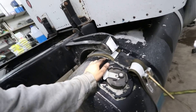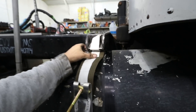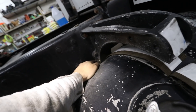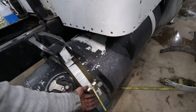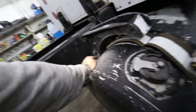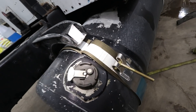I got the strap around — from the top here, down around the tank, and up to this side. What I'm not a hundred percent sure on is what to do at this point. Do I just take the sticky liner off until I get to the frame mount, push this up and have it on there, then pick the tank up and do the rest? Or do I stick it all the way around and then pick everything up? I think I'll unstick it to the point where the frame mount for the tank is, stick it on there, pick the tank up, and then stick the rest to the actual tank strap and go from there.